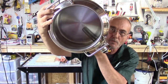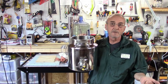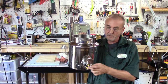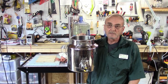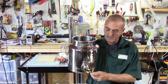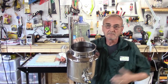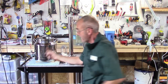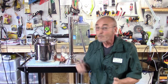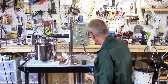Our three-gallon kettle has a 2000-watt heater element in there — there it is. If you follow some of the other videos, these are two wires, black and white, for 120 volts. There are only two screws on here, and you've got one ground which I'll mount with a clip. It's not polarity-specific, so it doesn't matter which wire goes where — just wire it up and plug it in.